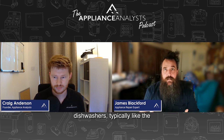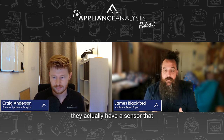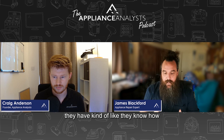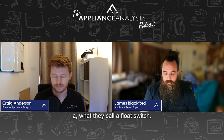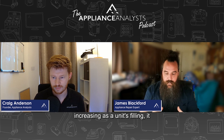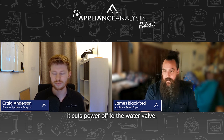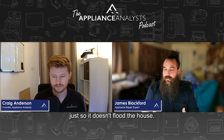As it's filling, some dishwashers, typically the LGs, the Bosch, the GEs, Samsungs, actually have a sensor that monitors that water level as it fills. Your Kenmore, Whirlpool, Maytag variety don't so much have a sensor as they know how long it's filling. And then they have what they call a float switch. Every dishwasher has a float switch in one way or the other. Basically, as the unit's filling, the water level reaches a certain point where the float activates the switch, and it cuts power off to the water valve. So that not only tells us that it's full and ready to wash, but it's also a safety measure so it doesn't flood the house.